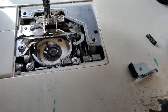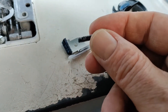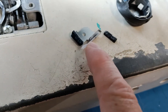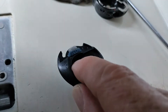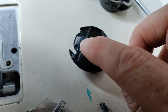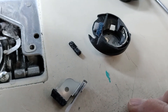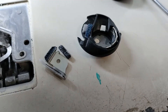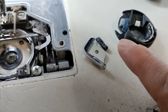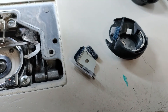Also, when cleaning out a machine, you don't want to accidentally pull out these little brushes. These pile brushes are located usually on the cutter assemblies and on the front side of a lot of bobbin cases. You've got to be careful not to pull those out, because they're really important and they help hold the thread while it's being cut. Be careful when using tweezers and brushes that you're not pulling those out, as sometimes they're loose and the assembly will have to be replaced.